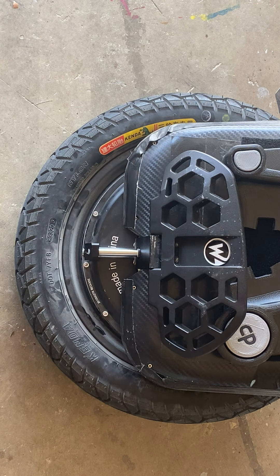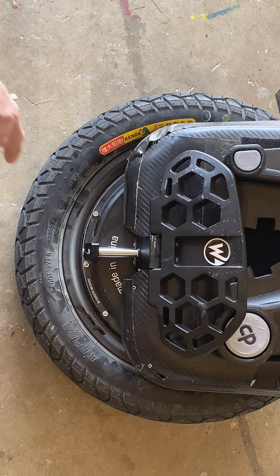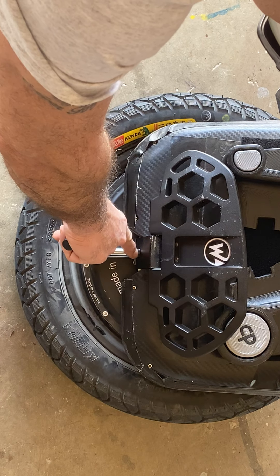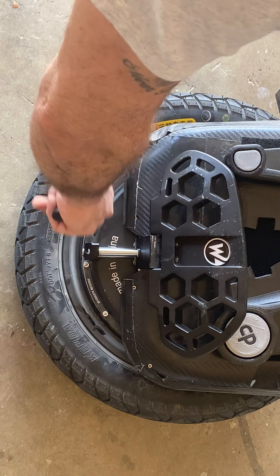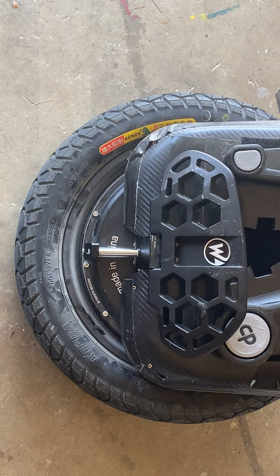On my EX, the right side air chamber loses air. You would notice that when you go over any bump or down a curb it bottoms out — the top of this cylinder is coming down and smacking into this black block at the bottom. The only thing that can be bad in this very simplistic suspension system is that air chamber.